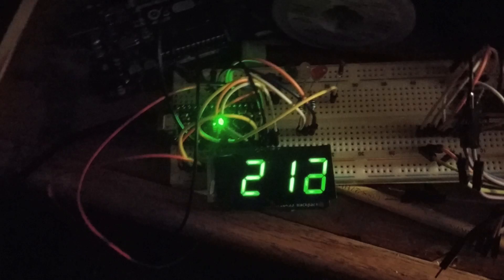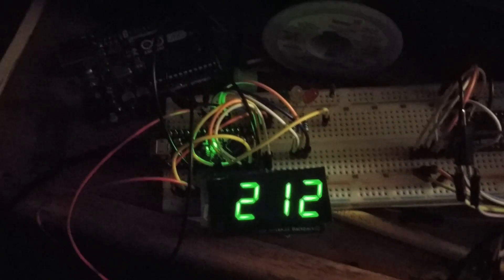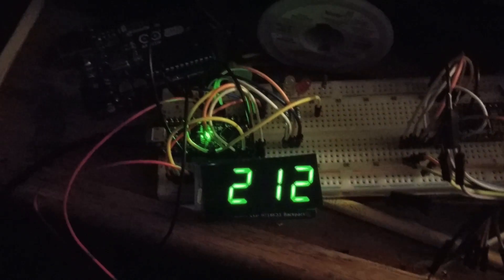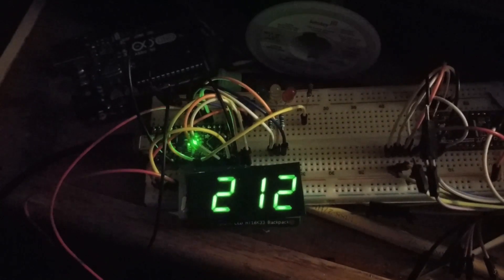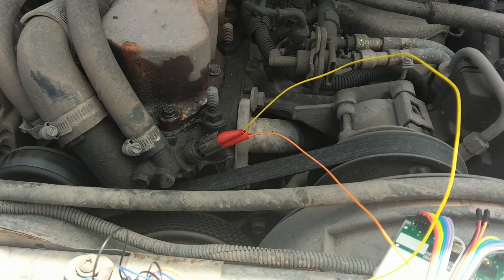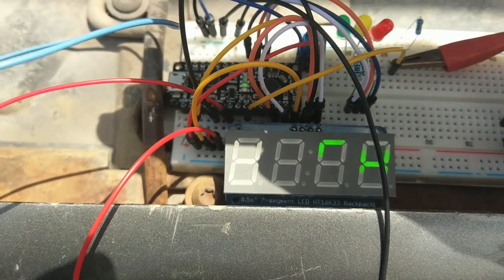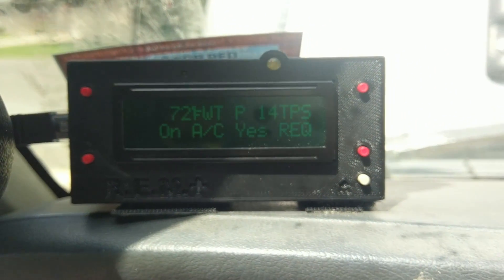We can play around with the temperatures they flick on and off to see what we like. It depends on how quickly our temperature sensor actually reacts to the engine and the fan. This is going to be a tuning procedure - once we get it on the vehicle, we can play with the specifics. But for now, proof of concept is working great. So now let's get on to the real circuit. I got this out of the Jeep, and with our proper formula this time it says 68, which sounds about spot on.